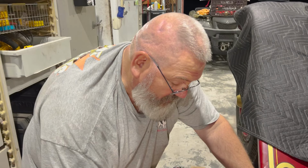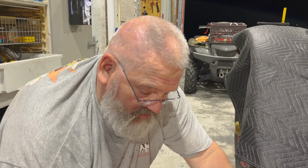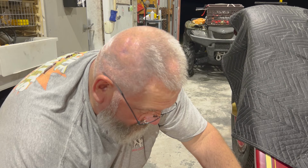They didn't have oil filters on them, so they would get gunk built up. So all the sediment and all this stuff just settles in the bottom of this thing. And luckily, this pan is big enough that it was down there and hopefully wasn't going through the engine. No, the pickup was above it. Did the pickup look good? It had a little bit of crud on it. I'll show you guys in just a second.